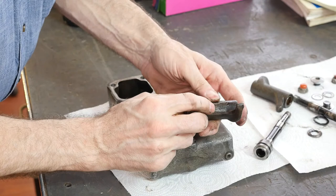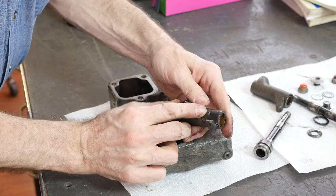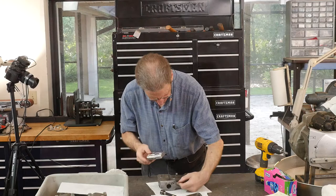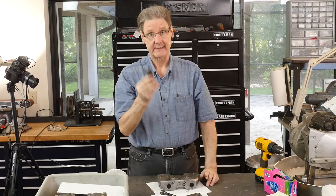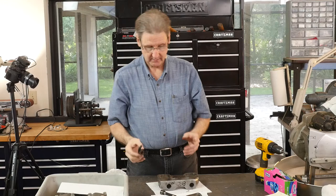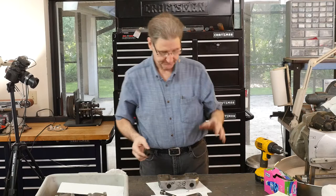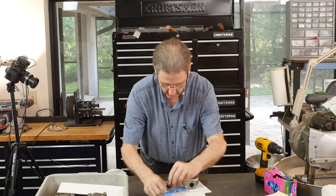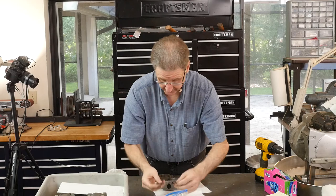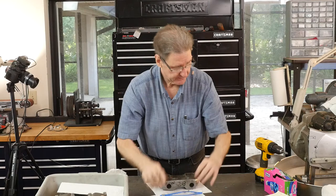Here's the exhaust side of this back head — see that tiny little hole right there. If I remember right, you can get this exhaust rocker over on the other rocker box's intake because they'll swap around, and then you won't be getting this little oil squirt over the exhaust valve. I'll do the other one, and I'll leave the O-rings here to remind myself.